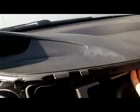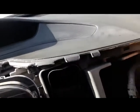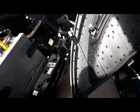After that, you just pull this straight toward you or toward the back of the car. Just find a place where you can grip your hand — this thing is supposed to pop out because it's held in by clip. I put my hand in there and pull it out. On the back, that's what it looks like — it's just held in by clip. I'll leave it to the side.